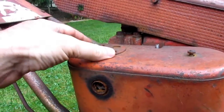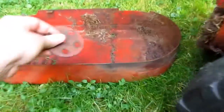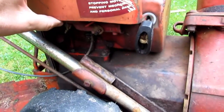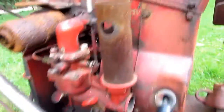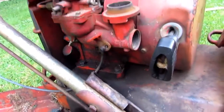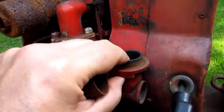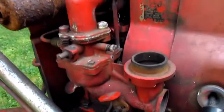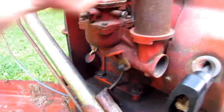I loosened up everything here on the cover — the carb cover. This little adjustable air thing comes off. This screw goes all the way down through the carb intake to hold this on. Dan, it looks like you're missing this guy. This is some kind of air intake tube, and then this guy sits on top. It's kind of a plasticky, rubbery type material — it's not metal. It looks like from your pictures you don't have either of those, but you probably don't need them. This is just the air intake for the carb bowl; it would probably run without those.